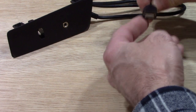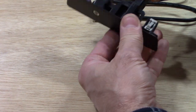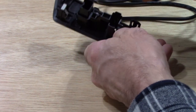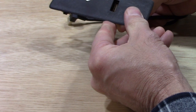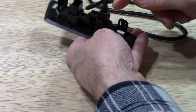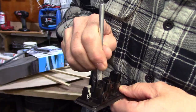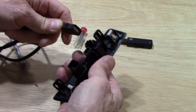You don't want to just hang the USB out of the dash or mount it underneath — that's inconvenient. Luckily it slides into the blank plug opening, but there's nothing to hold it and it doesn't go all the way flush. I need to trim some of the little ribs on the inside of the opening so the USB sits flush with the panel. After about 10 minutes of cutting with an X-Acto knife, it slides in right up to the surface without distorting anything.